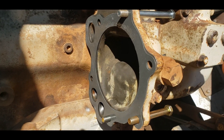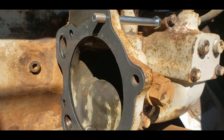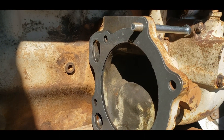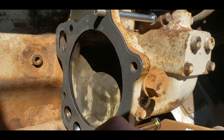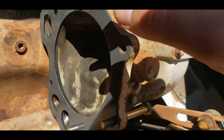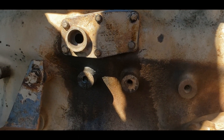Slight change of plans — the threads are captured in the block, not the cooler housing, so I thought: do I really want to lift that heavy oil cooler, shove that one piece into the block, balance everything, and try to start a bolt? Instead I'll give myself some locating studs to make it easier. The MCBee gasket has a plastic wrap coating that I think will seal a little bit better. Now that we've got our studs in place and the gasket hanging, I'll grab the cooler core, throw it on, and put a small bit of lubricant on the O-rings going in.